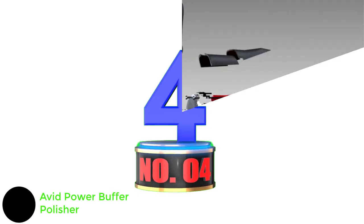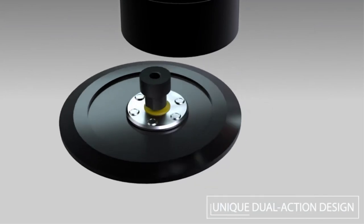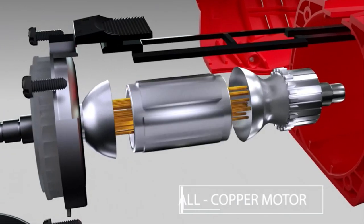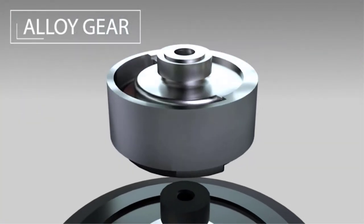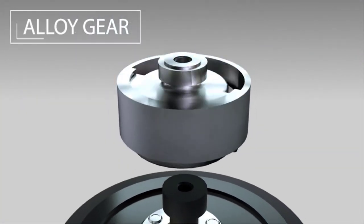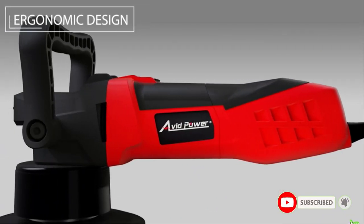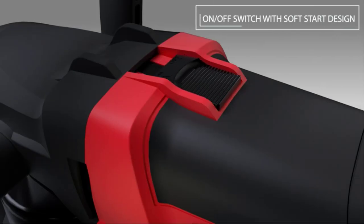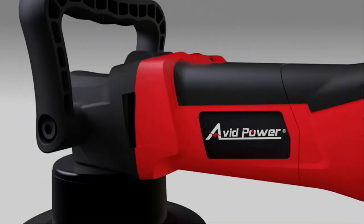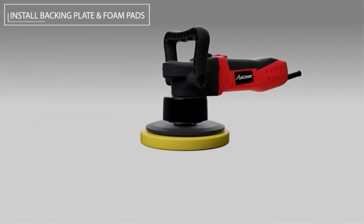Number 4: Avid Power Buffer Polisher. The Avid Power Buffer is an excellent choice for those on a budget. The buffer comes with three pads for heavy, medium, and light cutting. This corded buffer is louder than most, ringing in at 91 decibels, but is sturdy enough to remain undamaged after our drop test. We did find that the grip points on the body of the tool were not the most comfortable way to hold a polisher while under load, noting some discomfort during the five-minute hood test. Eliminating comfort from the equation, we think this is an excellent choice for starters — for a low cost, you're getting a powerful car buffer with three pads.